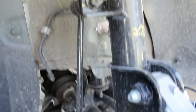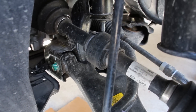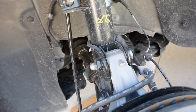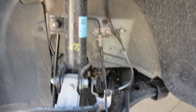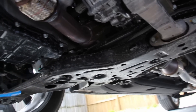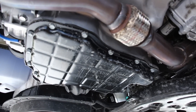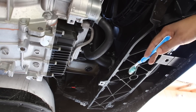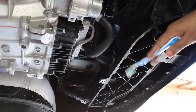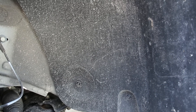At the front here you've got this long slender stabilizer link that connects up to the strut, and there's a lot of room in here to work on. Everything bolts up to this stamped steel subframe. The only thing I'd like to see here is more use of aluminum, the way Nissan has done with the Murano — using stamped steel kind of screams cost cutting, although this isn't really a luxury SUV. The front subframe is actually just there to tie the suspension components together and doesn't extend anywhere further in front of the powertrain assembly. The only structural member that goes past the powertrain is this front frame rail, which joins to the bumper reinforcement behind the plastic bumper skin. All the rest under here is your plastic radiator support that supports the bumper and headlights up front — it doesn't really serve any structural purpose.